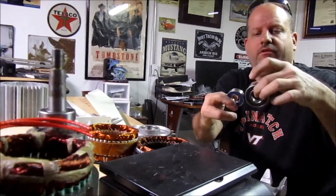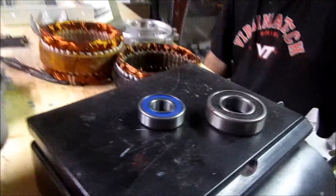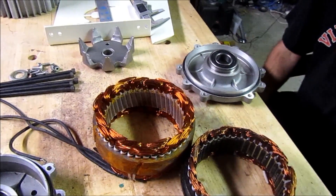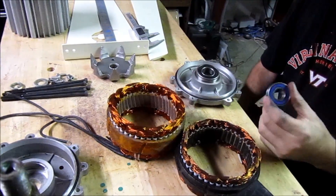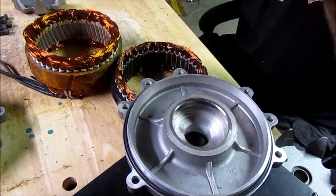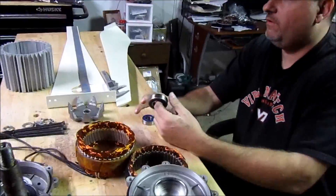Here is a 17 millimeter bearing compared to the bearing that we put in this White Lightning generator. This is the front cap of the White Lightning generator, and this is the bearing that goes in it. Now, this is the same bearing that goes in the Delco and the same size bearing that goes in the competitor's generator. When you look at this bearing inside of this front cap, it's just ridiculous — the size difference. These can be made with SKF bearings.